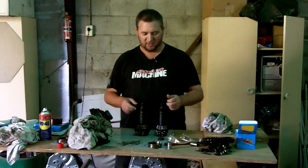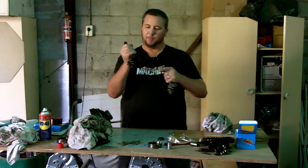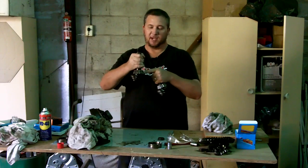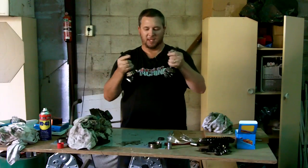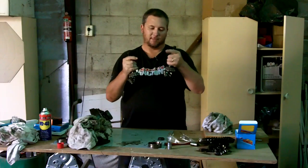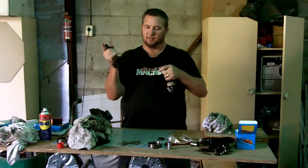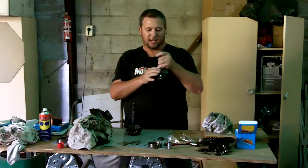Okay, so we've hit our first major snag. Don't know if you really can see on that video, but this is the pinion that came out of the car, the 308 pinion. See, the bearing here is quite a bit larger than the bearing here. Now they told me the bearing on the EL Falcon is supposed to be a small pinion bearing, but obviously it's larger. The changeover period was supposedly AU, but I think they must have snuck some into the late ELs.